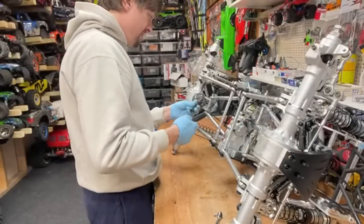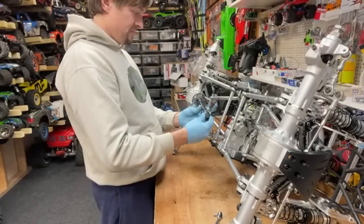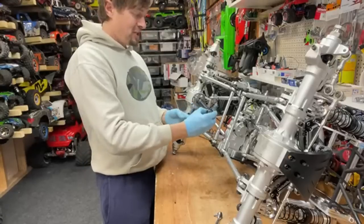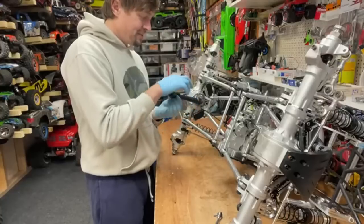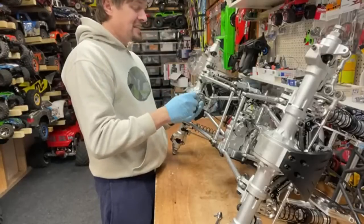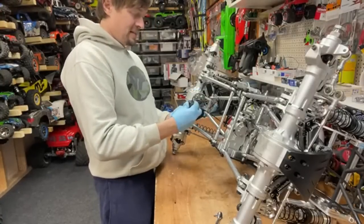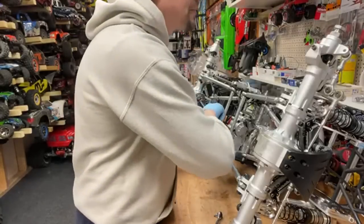Yep, that's on right. You've got to make sure that you put this on the right way around, otherwise you get the phasing wrong, then you can get vibrations. Whichever way these pins are this end, you want it the same that end. Otherwise you can get funny vibrations, because as a prop shaft is at an angle, this section here speeds up and slows down. If you have it 90 degrees out, that means your phasing's wrong, and that means it speeds up and slows down the axle. But if you've got this end the same as that end, then that will speed up and then slow back down when it goes there. So it will match up, if that makes sense.